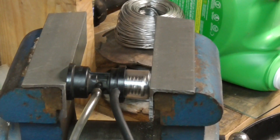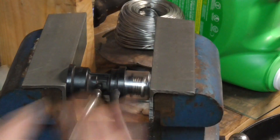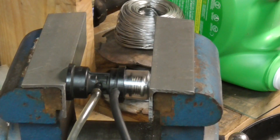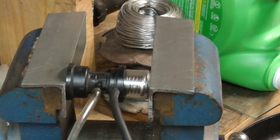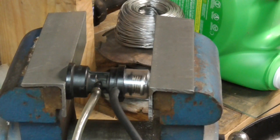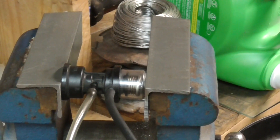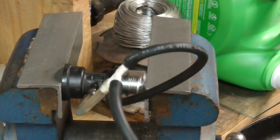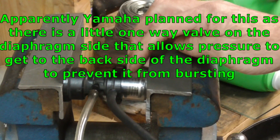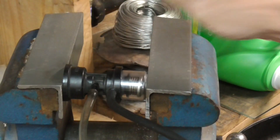This one is a little messed up because I took it apart — it no longer just gives one burp, it'll just continue to burp because the spring has gotten messed up or the cap isn't the right distance. But you get the idea — you can see the little valve moving back and forth when I pump it up. In the same respect, if I take the vacuum off and put air into it, it's going to blow off, which is what it's really been doing most of its life.